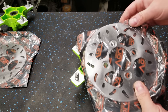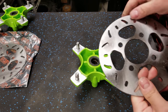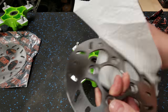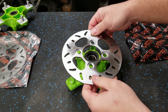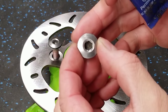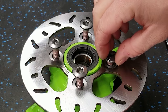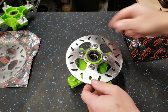I did get some brand new disc brakes because those old ones were all cracked up. These are made by Volar - fairly inexpensive, nice piece. I'm going to wipe these down with a little bit of lacquer thinner on a paper towel because they feel like they have just a little bit of oil on them - last thing we want is oil on our brakes. Flip it over - one side has a recession for the bolts, this side does not, so we put it this way with the recessions facing up. I'll put our bolts back in with a little bit of red Loctite. I am using one replacement bolt since we had that wacky stripped bolt.